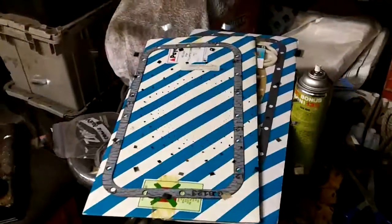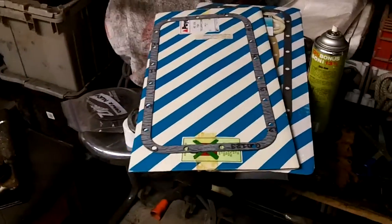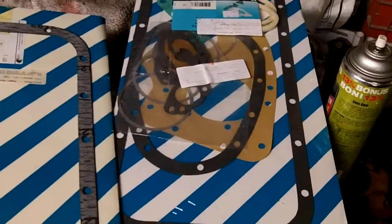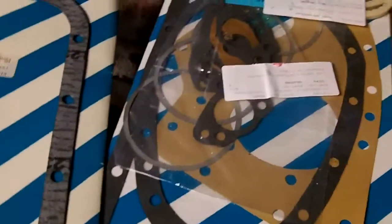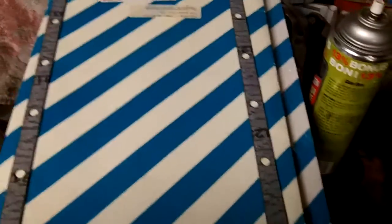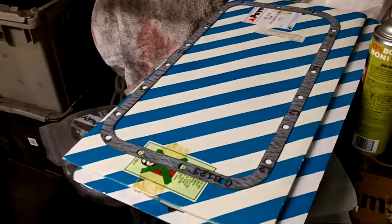I went into the basement and dug into my parts bin and found that I actually have a couple of gasket sets for the TR3. I've got a really nice oil pan gasket - actually I have two of them. They're both pan gaskets, but this one seems to be a little more substantial than the one that came in the kit. That's a bottom end kit basically - it's even got the figure-eight gaskets for the piston liners. We're going to go ahead with this nice oil pan gasket. The oil pan has all been cleaned and painted as well, so we'll get that back on the car once we dig out the oil pan bolts.